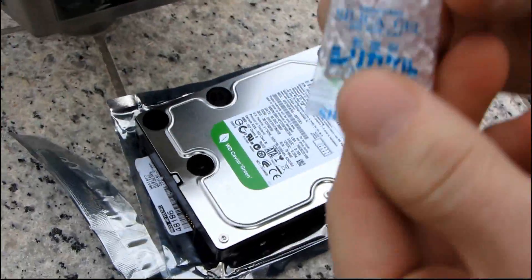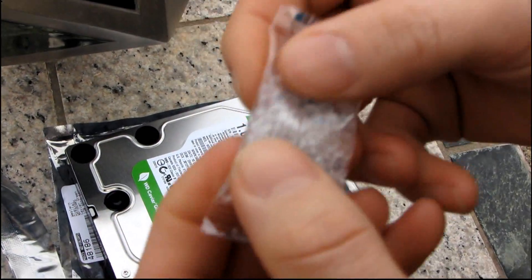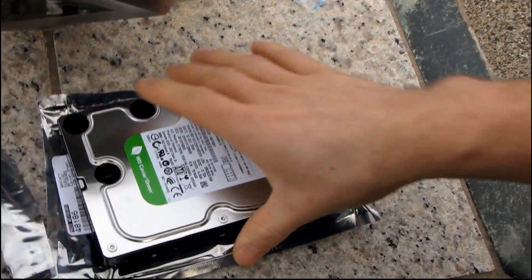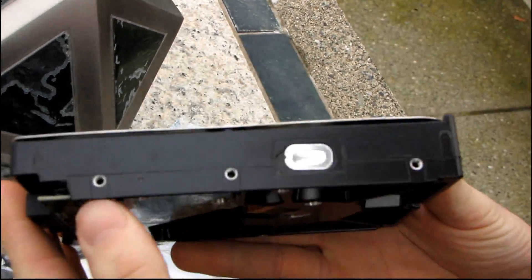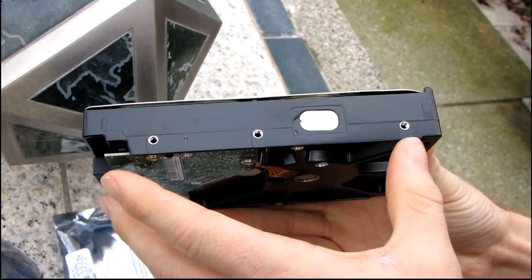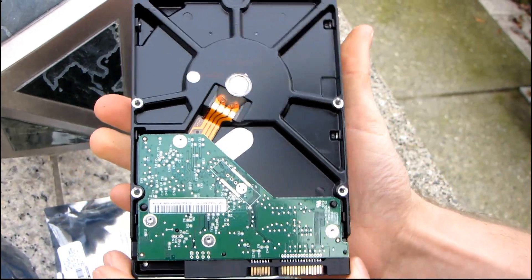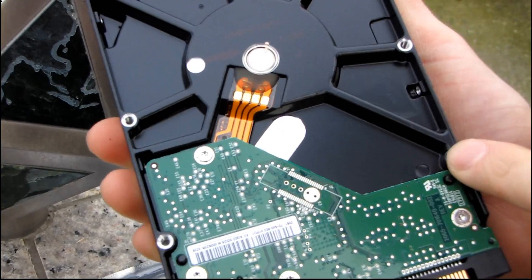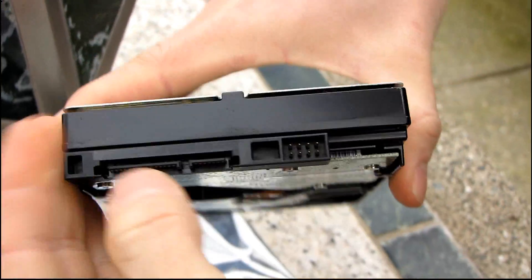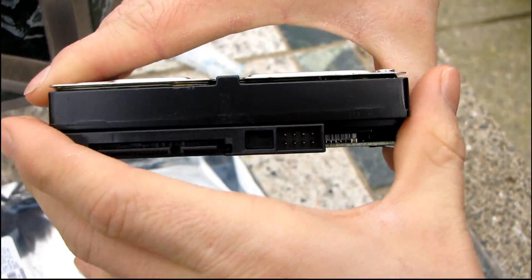There's the drive itself, and inside we will find — I'm very fond of these — a silica gel packet. Don't eat that please. Okay, let's look at the drive physically. It's a pretty typical three and a half inch drive: three mounting holes on one side, three mounting holes on the other side. On the bottom you'll find a standard-looking PCB with two mounting holes on either side, and at the back a standard SATA power as well as a SATA 2 interface with some jumper pins.